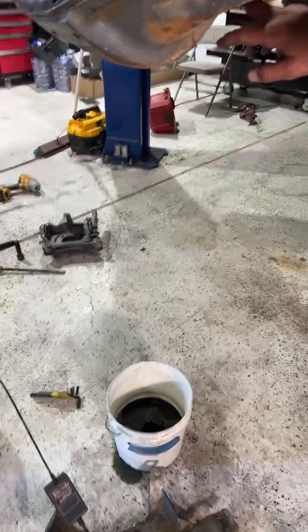Okay, so in addition to that, I'm changing my gear oil. So I just drained the differential. We're going a little cooler of a season. So what weight are you going with? Yeah, so I'll probably go 75-90. Normally I would run like an 85-140. It just depends what we're doing, especially if I'm going to go snow wheeling and all that. You want the lighter weight oil. A 75-90 has been the norm for gear oil forever. It's only since then that they've come out with the more heavy duty 140 version.